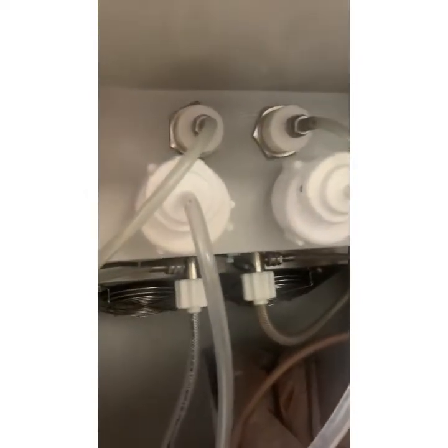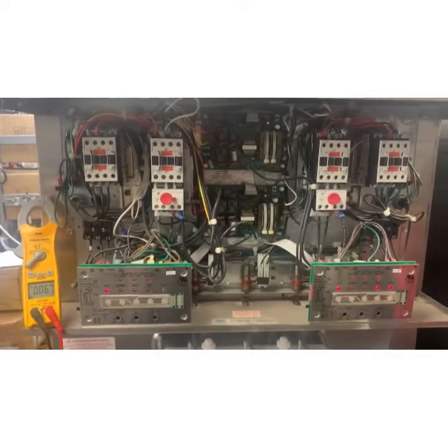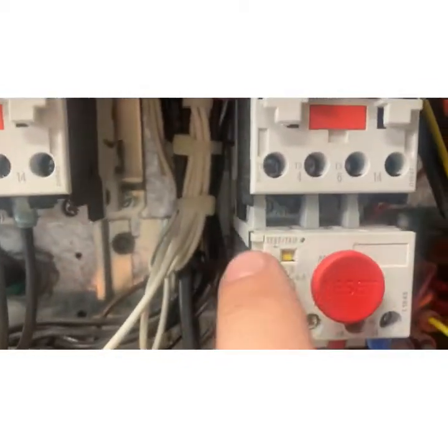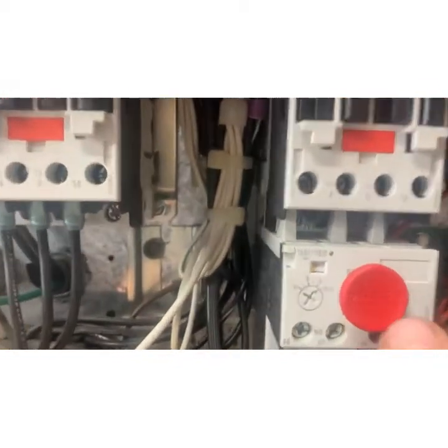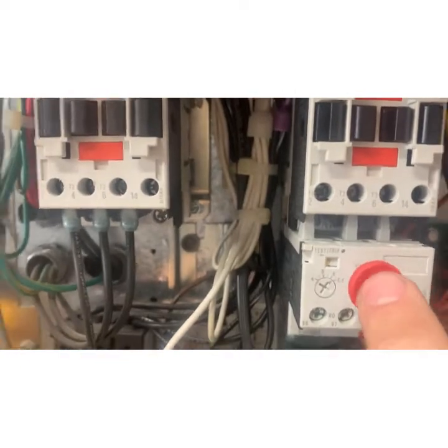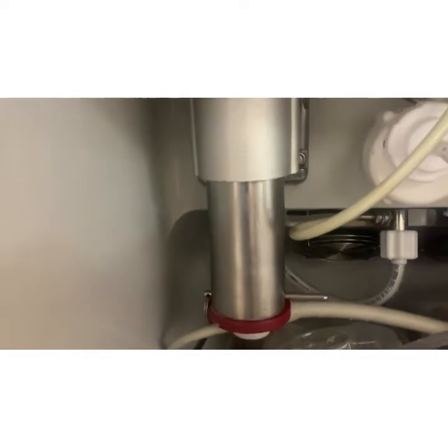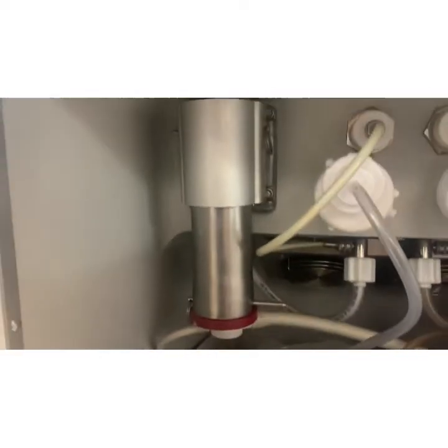Alright, give me a second. Let me get a better view of what we're doing. Here's behind the curtain — they have a reset button on the outside. So this is tripped. When they press the reset button, you can see how it goes all the way back. It hasn't reset yet. Okay, I got it to reset. And now when I turn the pump button on and open this up, the pump does run. So that was the interrupter problem, but I actually think it's going to be something bigger than that.